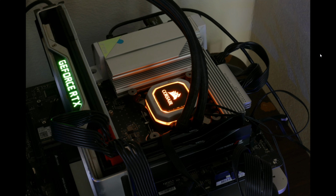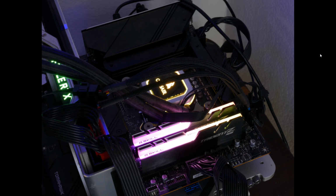So no XMP here, although we do have an XMP version of this, and that XMP version does use XMP on both DDR4 and DDR5 on the entire lineup used in our reviews. So here's the thing, another G-Skill kit, DDR4. Now this is XMP rated to 3600 megahertz, so in the XMP article you'll see it at 3600 megahertz, but here it's at JEDEC 2133. Like I tell them, if you want me to run it faster than that, have it go at that by default.